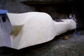Use a Surform file, often referred to as a cheese grater, to remove the high points. If the file skips over the surface without biting into the body filler, it's already too late and you will have to level that area with a sander. As the file bites into the body filler, the material should come off in small curled pieces.